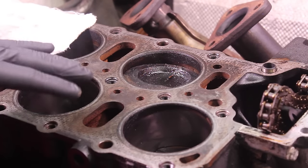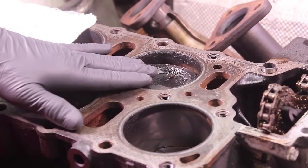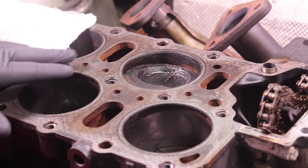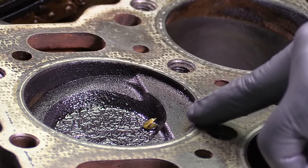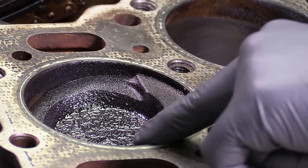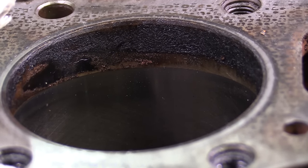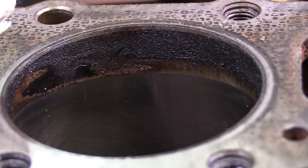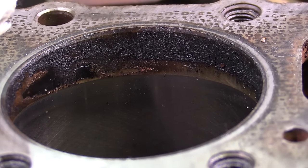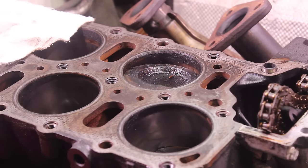In addition to that, if you had an engine that was consuming oil or had other problems, we may want to remove the pistons, re-hone the cylinders, and clean it that way. But because this was a pretty good running engine, I just want to clean this carbon buildup on the tops of the pistons as well as back here in the combustion chambers. The small portion around the cylinder where the clean spot stops — that's the combustion chamber — and if we leave a bunch of carbon buildup in that spot, that can lead to hot spotting when we get the engine put back together.